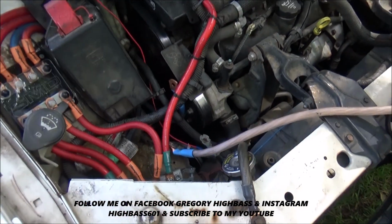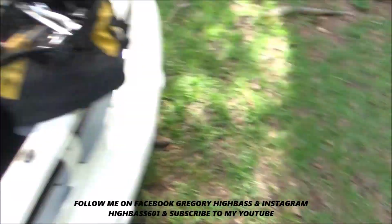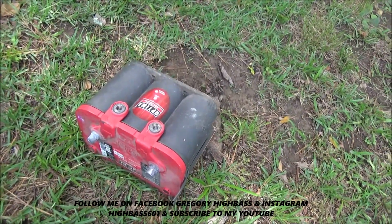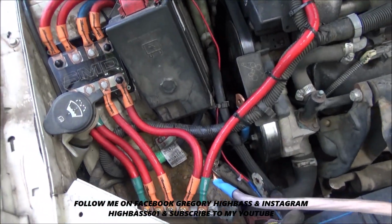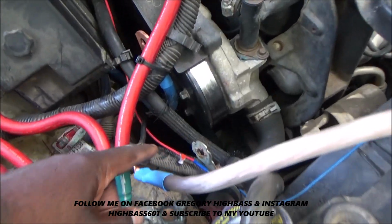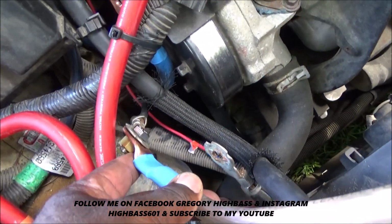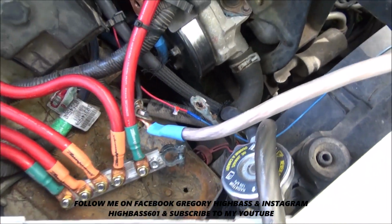So he has 2 yellow tops in the trunk of his car. That's not a side post. That's a side post on a top post. So his yellow tops in the trunk are top post only. But the problem I'm having now, his factory cables, his ground cable right here, and his positive cable, is too short to reach on top.